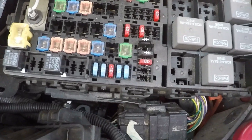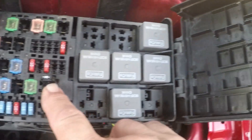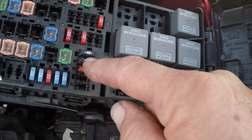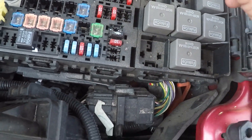I looked in the owner's manual and it says this diode is the fuel pump diode — it's number 36 on the little chart over here. So if I pull that out, paying attention to which direction the arrow goes, that should stop the fuel pump.